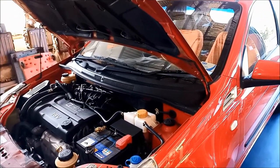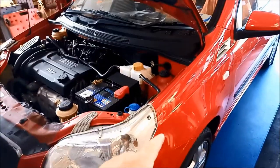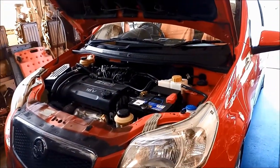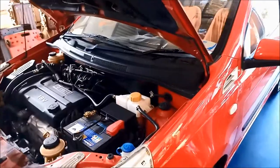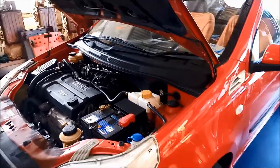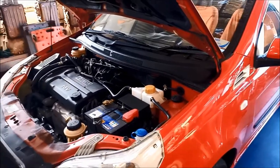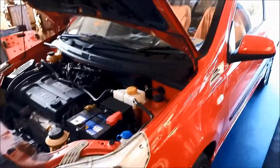We've also gone to an empty car park and driven at full lock to the left and full lock to the right, just to try and see if there are any noises in the CV shafts. If they're worn, quite often the steering wheel all the way to one side, either left or right, can indicate which side is worn or making a noise or has an issue.